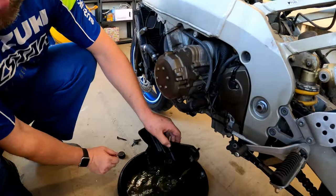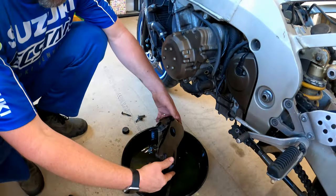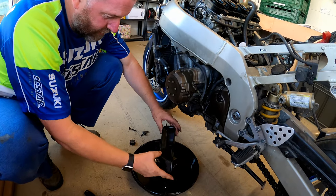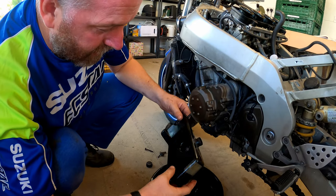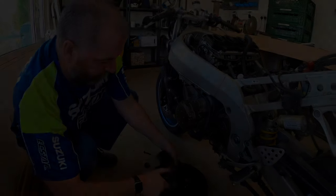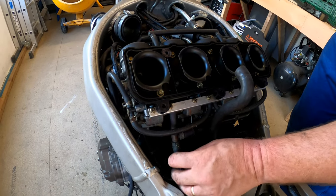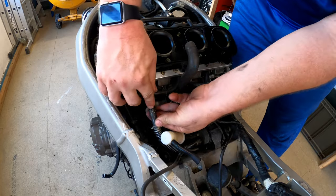Yeah, there's oil in there. That's the reason why it wasn't emptying out - because it's completely blocked, probably with gummy oil. Look at that. Looks like we've got tripe in our coolant bottle. The bottle itself looks fairly serviceable though - that'll sort out with a good clean. Right, as I said before, let's move on to the carbs. Where we want to start is the fuel feed from the pump. That clip should be securing that hose to this tee piece - the previous owner has kindly left that off for me.